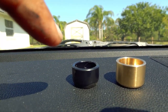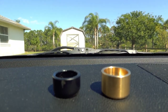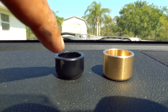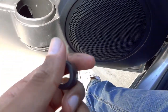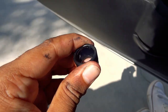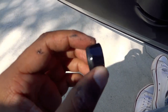On the NC2s and NC3s, this piece — the diameter — is bigger than the NC1. That's why this brass piece doesn't work with years after 2009. They addressed the durability issue of the nylon bushings with a larger diameter in the NC2s and 3s. The factory nylon collar that came out looks pretty solid, no real signs of wear — I'll probably just keep it as a spare since it doesn't look like it's going to break anytime soon.